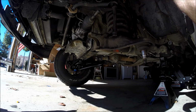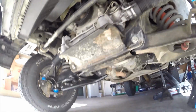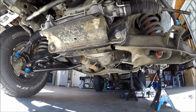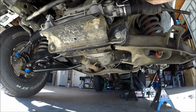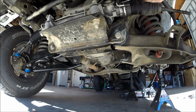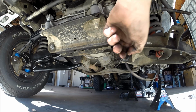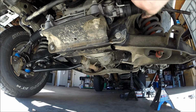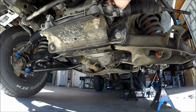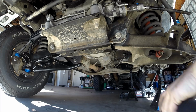And then next we have a sacrificial clamp on the back that we need to take off. Alright, so here's a look at the clamp that we need to take off. You're going to try and get right in that little nook right there, and so lift it with a flat blade screwdriver. Alright, that screwdriver's too small now. We're going to move to a bigger one. There it goes. This is a one-time use type of thing. You can get a hose clamp, but I just use the zip ties that they provided in the kit. And so you got to get it off this breather hose here. And there it goes. Just like that.